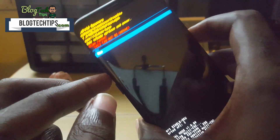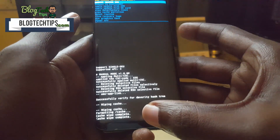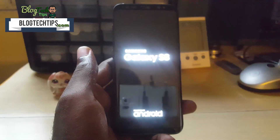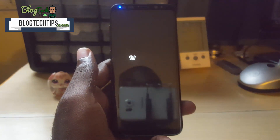Select 'Yes' and there you go — it says 'Wiping cache' then 'Wipe cache complete.' Then hit power again to select 'Reboot System Now.' You are now finished — that's how you wipe the cache partition of your Samsung Galaxy S8 or S8 Plus as fast as possible.